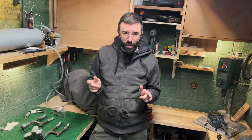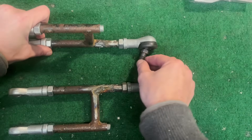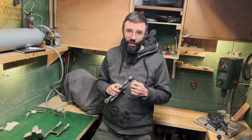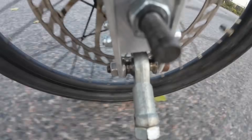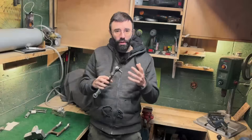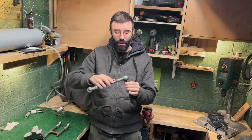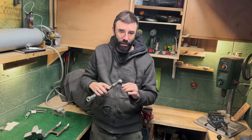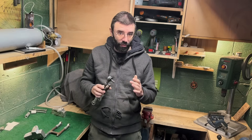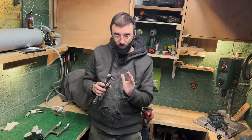For this video I made a couple of changes. First, the type of ball joints that go into the wishbones. I prefer this type because, as we saw in the other video, with the other type I don't have enough steering. With these ball joints I prefer to sacrifice the amount of tilting but keep as much steering as I need. This changes nothing of the steering and suspension geometries apart from the range.